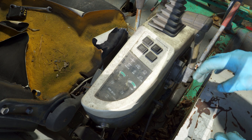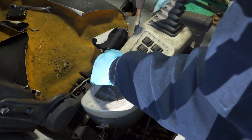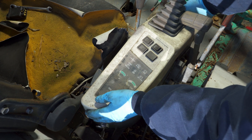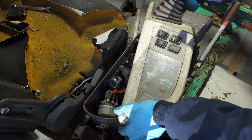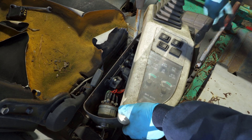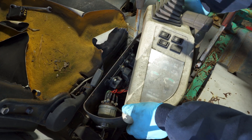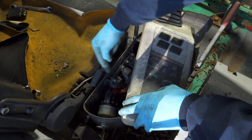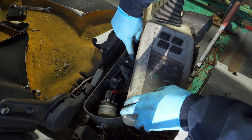The first step is there are a few screws around this steel casing that holds this bezel on — loosen or remove those, and then you can lift this top cover off. All you really need to do is pivot it out of the way, but be careful because the tabs that hold this on are pretty fragile. You can see your ignition switch here, this is the glow plug timer module, and this is the glow plug relay.